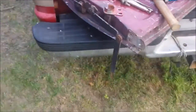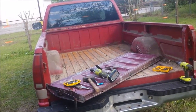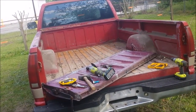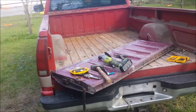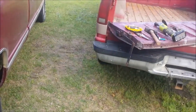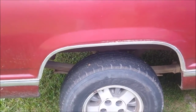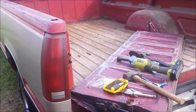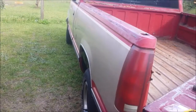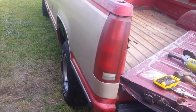I don't know which truck I'm going to put it on. I might put it on that one first because I'm going to try and get that one on the road, then work on this one too. Ain't that much wrong with it — I'm just going to tighten up a few things and do a little tune-up. This one has better tires. That one has dual exhaust; this one has no exhaust — it needs a muffler. It has a catalytic converter but no muffler. I'm going to put a muffler on it and paint it with heat paint first so it doesn't rust out as quick. A lot of these old trucks burn through mufflers.